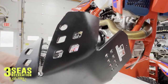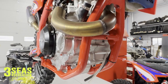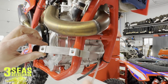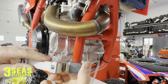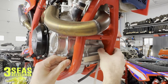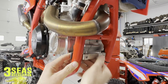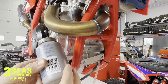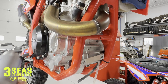Now all we have to do is hook this up into the front. There's a bracket that came with this. The first thing we need to get into place is one of the back brackets — this is an addition to the stock two bolts, one of the TM Designs extra pieces. They give you two rubber grommets that go over the middle to protect against the frame. The easiest way to get this in here is to come through the side — it doesn't have a lot of room. I do love to use never-seize on everything since this lives in an environment where it's always wet and dirty.